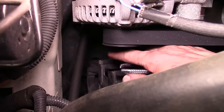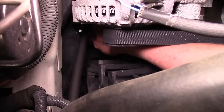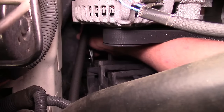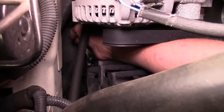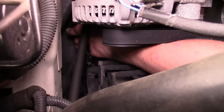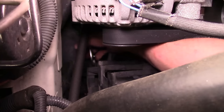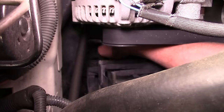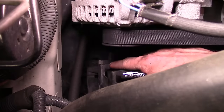I'm going to get to the radiator drain from up above. As you can see, that's the alternator and that's the belt. I have thin, narrow arms so I can do this without too much of a problem — some people might not be able to. I can get down here, prepare a pair of pliers, and work on rotating that drain. I've got a catch pan directly under there to catch any runoff. If you want to do it from down below, you'd have to remove the plastic shroud underneath and crawl under. I have access from up here just because of the way I'm physically built, and that's how I do it to save time.